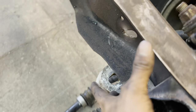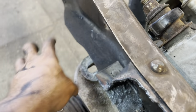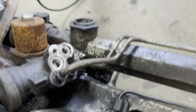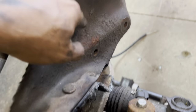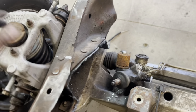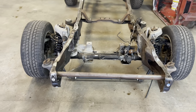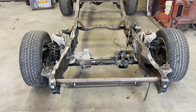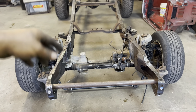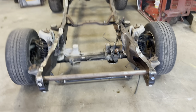This one I'm going to have to do a little bit of boxing and building on, but I'll get it where it mounts. This side will probably be all right if I leave the steering box piece in here. Before I continue, I'm going to buy some steel to plate the frame in on both sides, but in the meantime I'm going to get it all cleaned up and get the rest of this stuff out of the front end that I don't need.